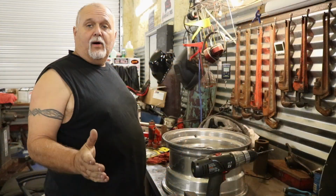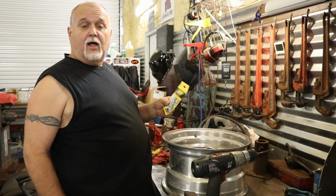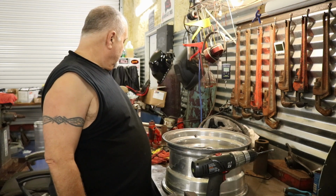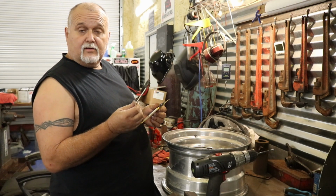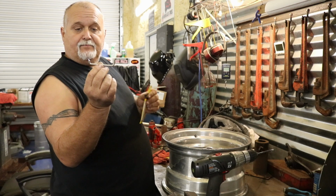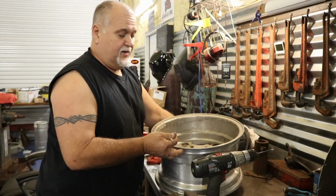putting them in. So when I bought my slicks, I bought it as a kit. The slicks came with set tubes, came with all the bead locks, which is 2 bags of 32 screws each, which actually puts you a few extra screws in there. Comes with a drill bit in each bag. Also, the kit came with this little kit right here that comes with another drill bit and comes with this little piece of metal that's bent. It's long on one side and got a scribe on the other, and pretty much what you do, I've already got this one side wheel done, so we're just going to do the other side for you.